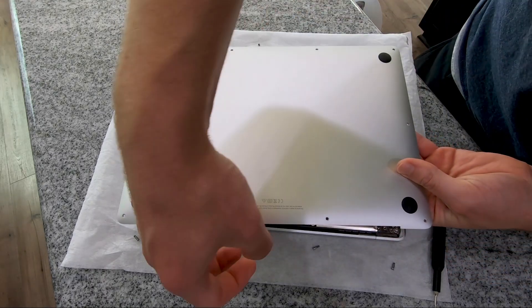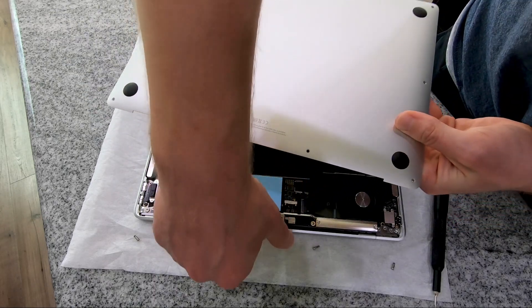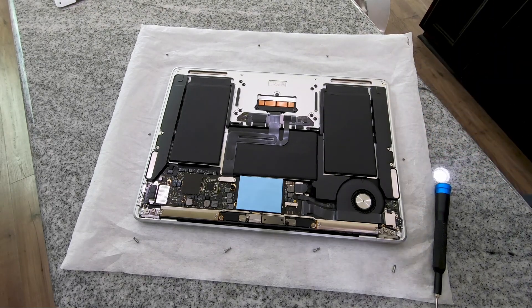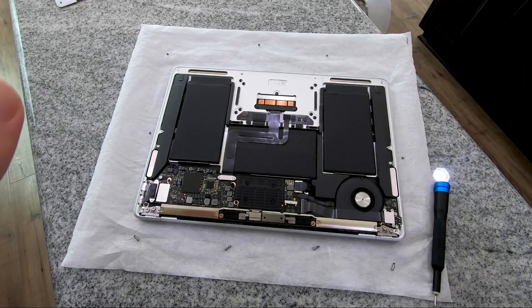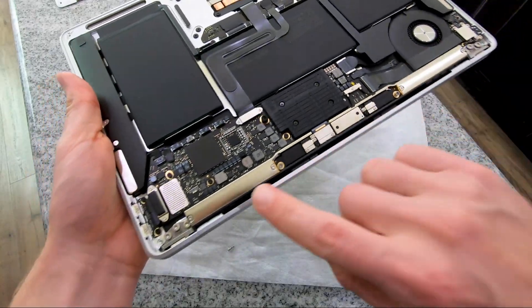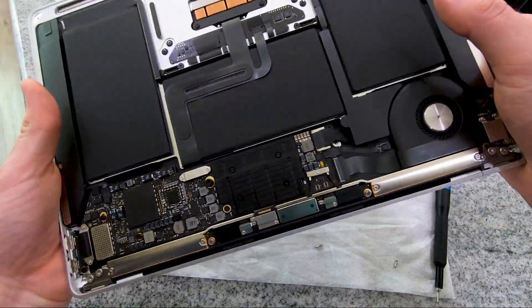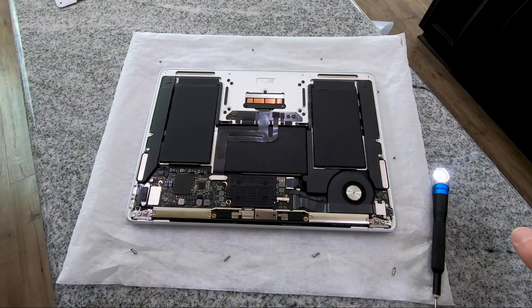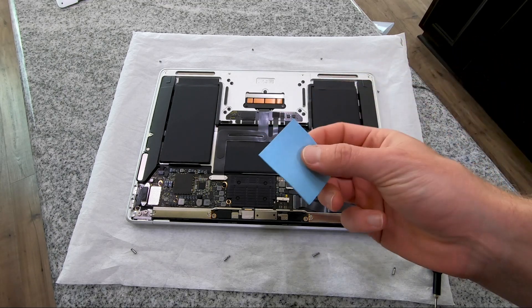Once you get all 10 screws off, you'll see two tabs in the middle. Take three fingers, stick two fingernails underneath the bottom and one finger on the monitor hinge, apply a modest amount of pressure, and it should pop off without an issue. This right here is our CPU and GPU — cold air comes in over here and is expelled over here. The fact that there's no heat pipe really isn't that much of an issue. This is a design that ultra-thins have been using since their conception and servers have been using for decades. The one server I had overheat was a 135-watt processor in an un-air-conditioned warehouse — I think it gets a pass.